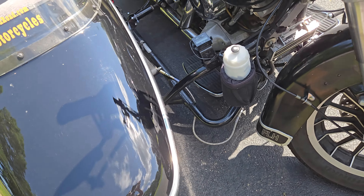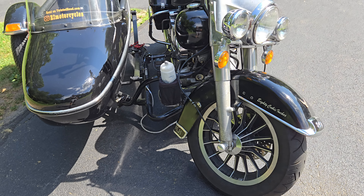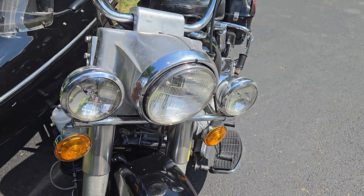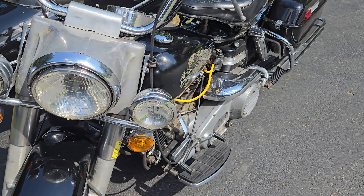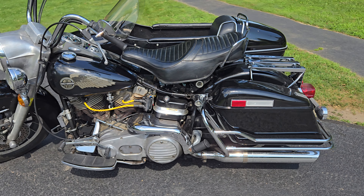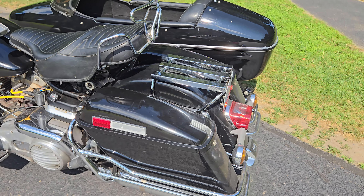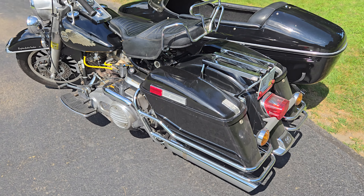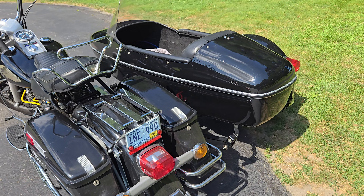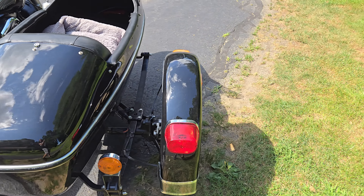Some hardware has been updated and things have been oiled. The harness connects and disconnects easily from the entire bike. I've also added a quick-detach brake line, so with the help of a little furniture mover or a stand, you can get this bike separated from the sidecar in about 20 minutes. Getting it back together takes a bit more because it's a dance shimmying it onto three brackets simultaneously, but pulling it off — keep some Amazon boxes around and the sidecar will just slide off easily.